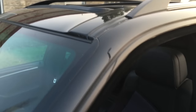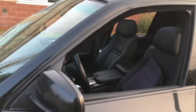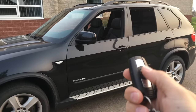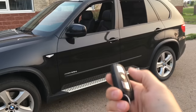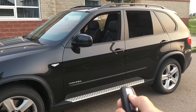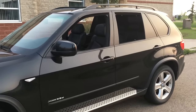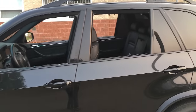Now here's a trick — this will not work in the North American market. I know there are a lot of guys on the internet that say this will work, but it will not work in most jurisdictions like here in Canada, and probably the US market as well. You can't re-close the windows with the button. Some markets allow you to re-close all the windows and the sunroof by holding the lock button, but obviously it's not working here. You have to do it manually, largely due to liability — they don't want you accidentally closing a window on somebody hanging outside.